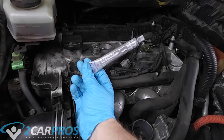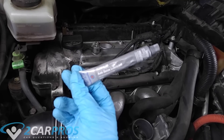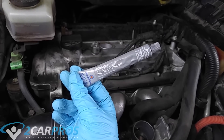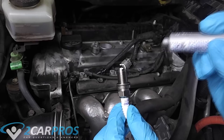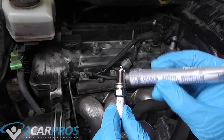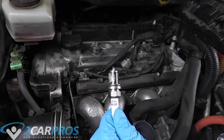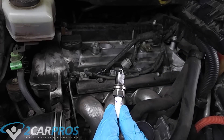Another tip: buy a small tube of anti-seize for spark plugs. I got this on Amazon for about $2.30. You apply a little bit onto the spark plug thread so the next time you remove them, they don't gall the threads. I probably used a little too much — you could use half as much and be just fine.